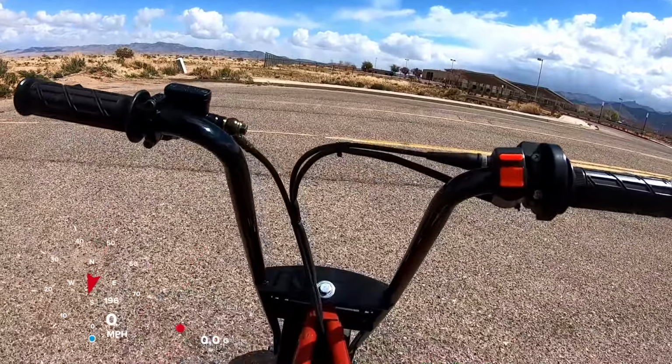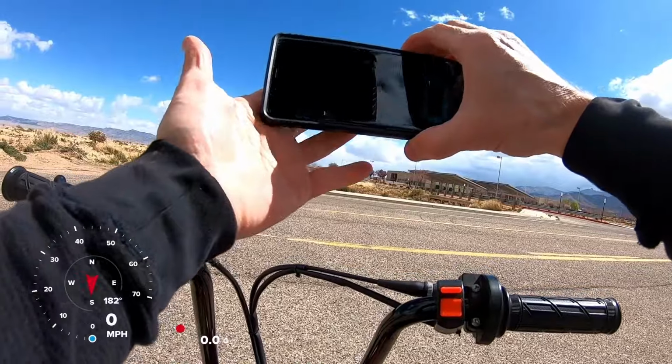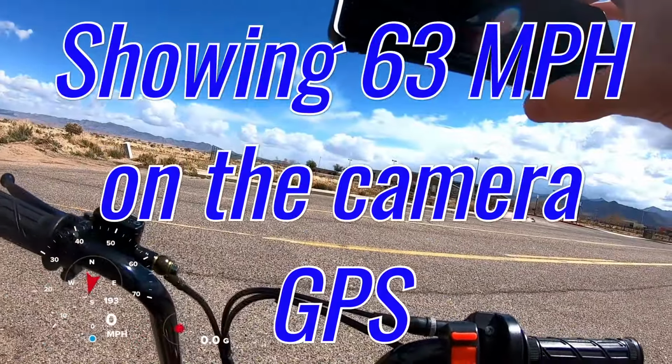Seems like it was moving out pretty good. Let's see what it did. Did a top speed of 62.65. So the cast aluminum flywheel didn't really pick up any top speed or 0-30 time or 0-30 quickness. It could be a good alternative because it's so light for a racetrack. Like if you're racing coming out of a corner and you need to gain RPM really quick.